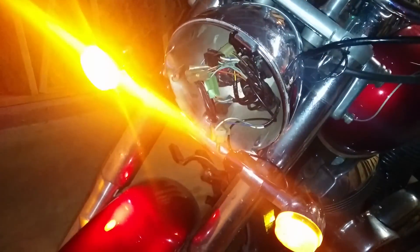As you can see, it is now flashing at a standard rate, and you don't hear it clicking. Since it's electronic and not mechanical, there is no more clicking going on. That same flashing pattern also shows up on your turn signal indicator.